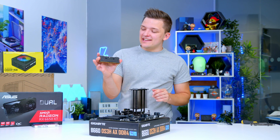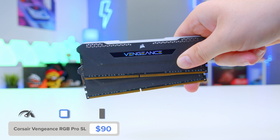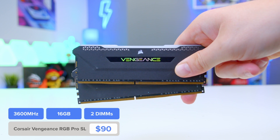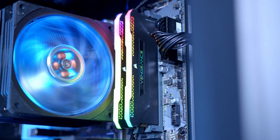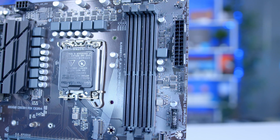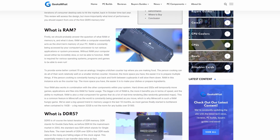Once the cooler is successfully installed, we can go ahead and look at the RAM next up. This is a 16 gigabyte kit of Corsair's Vengeance RGB Pro. 3,600 megahertz is a great speed for our Intel CPUs — anything higher is just surplus to requirements and will mean you need a more expensive motherboard to actually operate it. This is of course a DDR4 motherboard, not a DDR5 design. Personally, for any build less than about $2,500, DDR4 is where I would go.